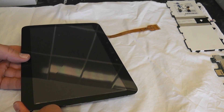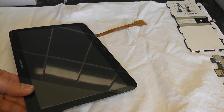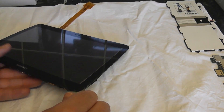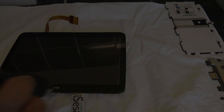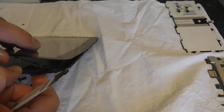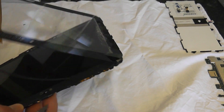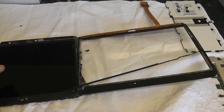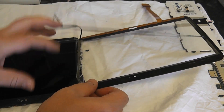This is where the crack is - we're going to get to the edge and then we'll have to get underneath that other bit of glass. This is very sharp so make sure you're wearing safety glasses, and if it's really shattered wear some gloves or put some tape over the outside of the glass. A little bit more heat just to loosen it up. You can see it's starting to separate now, working our way around. That bit of strip hanging down is just a glue strip, so don't worry about that. You can see it's just starting to shatter on that edge and we're going to pry this off and pull that little bit of glue off.